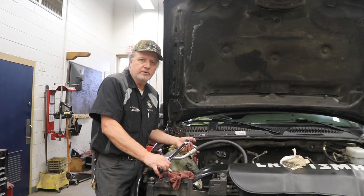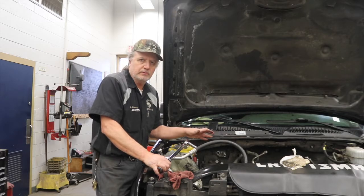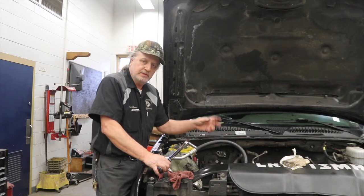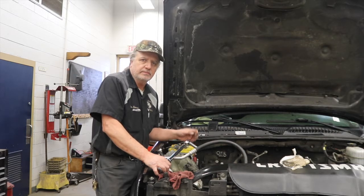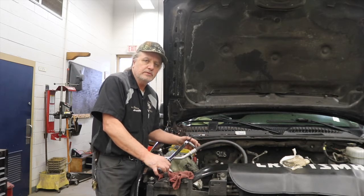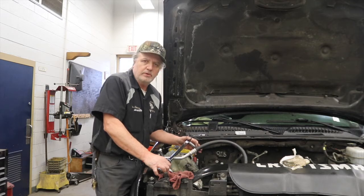The factory bolts for the Duramax are set up to do a small torque spec and then plus 60 degrees and then another 60 degrees. But with the ARP studs, they recommend simply doing the 3 steps that you would normally use to torque the head down, but up to 125 pound-feet, and that's all that's necessary.